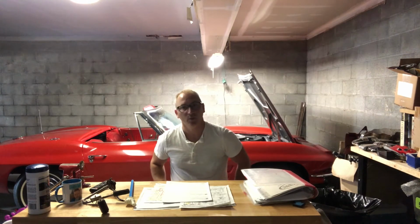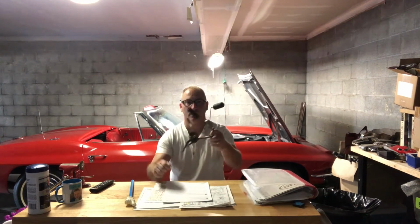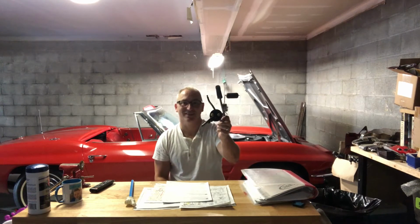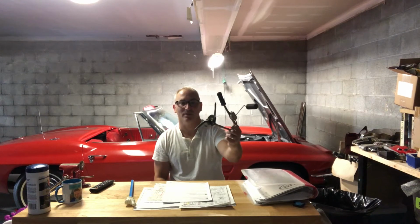So once I considered all that, like I said, I put everything together into a kind of punch list of low-hanging fruit and decided the easiest access I actually have is to the rear fuel sending unit, and disconnecting the pink, just that power to it, right away would be the simplest way to figure it out. So I jacked up the back of the car, took a look at the connector, and for the first time realized how weathered or used this fuel sending unit was.